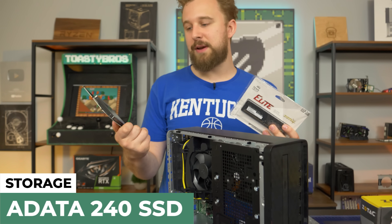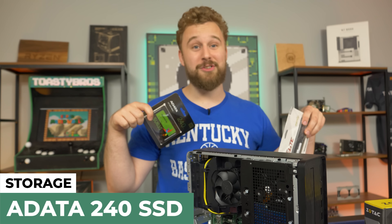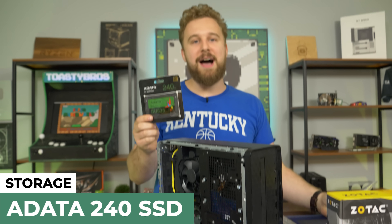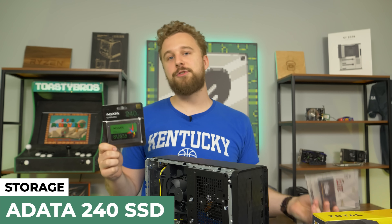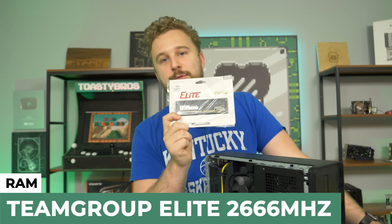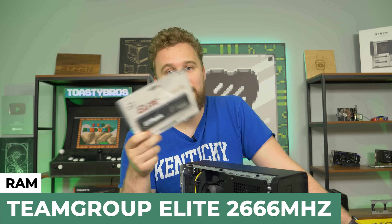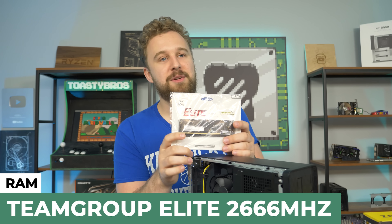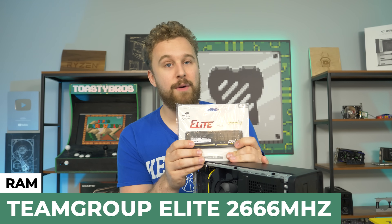The other upgrades, which are really easy to do, are an SSD and RAM. This is an ADATA 240 gig SSD — very basic SSD you can get on Amazon, links in the description. You can slap this in along with the hard drive. And then we got another stick of memory — we ended up getting another 8 gig stick because we forgot there was only 4 gigs in here. We thought there was 8 and were trying to make 16, but now it's going to be 12, which is still better than 4. Try to get the closest RAM speed you can to what's in the system — this looks like 2666 MHz RAM and should work perfectly fine.